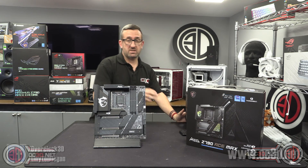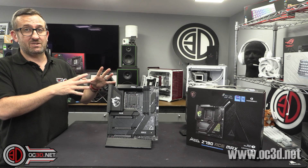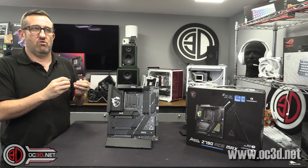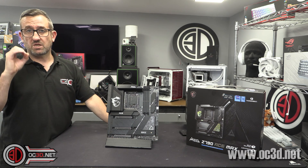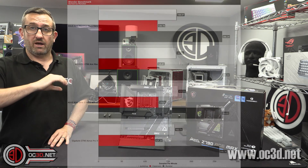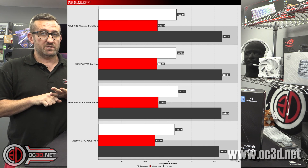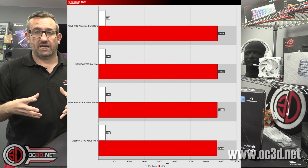The MSI boards — it's going to be settings within the BIOS — were about five to six degrees warmer CPU temp-wise than the other boards, but that will be down to the subsidiary voltages running slightly warmer. It's not a surprise, but it might get tuned down; the MSI BIOS team are normally on top of this. The performance they got out was definitely not shaming them at all. The performance between boards with the same processor is incredibly close — effectively we're just undervolting the processor, letting the boost do what it wants, because there's just not enough headroom for overclocking with the lid on.